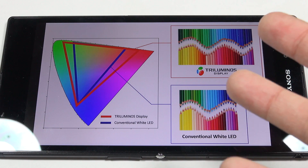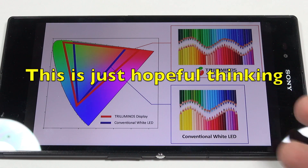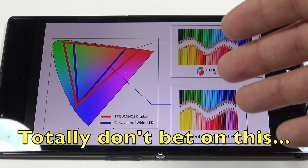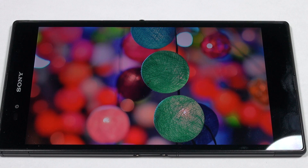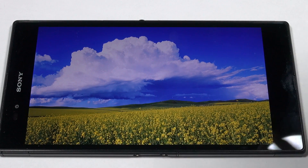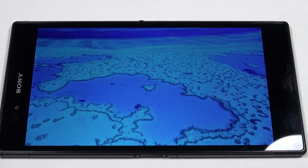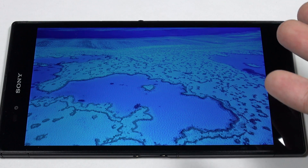My phone is on the latest firmware but does not have the X-Reality engine yet. Once they release it, I'm wondering if we'll see a change in the gamut — whether it will resemble what they promised in their press release. It's possible this could be a wider gamut LCD that they're currently keeping closer to sRGB until the X-Reality engine releases, which is supposed to add sharpening and make movies and pictures more clear. There is tons of processing and interesting calibration on this device, but at least it looks pretty. I actually really like this phone and this display despite the harsh processing. Thank you everybody for watching — please rate, comment, and subscribe. Give this phone a chance — it may not be an accurate media experience, but it certainly is an experience. Have a good night.